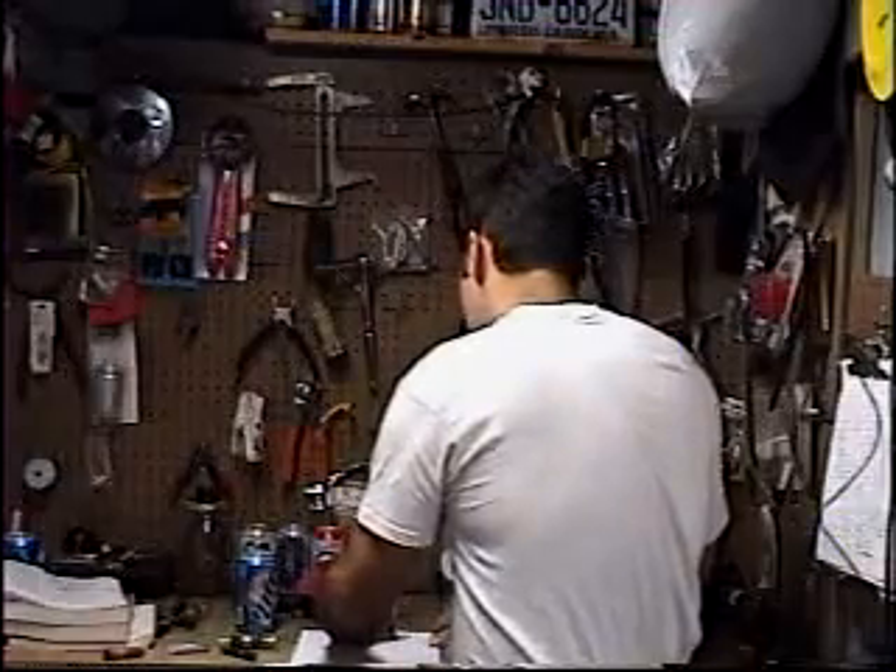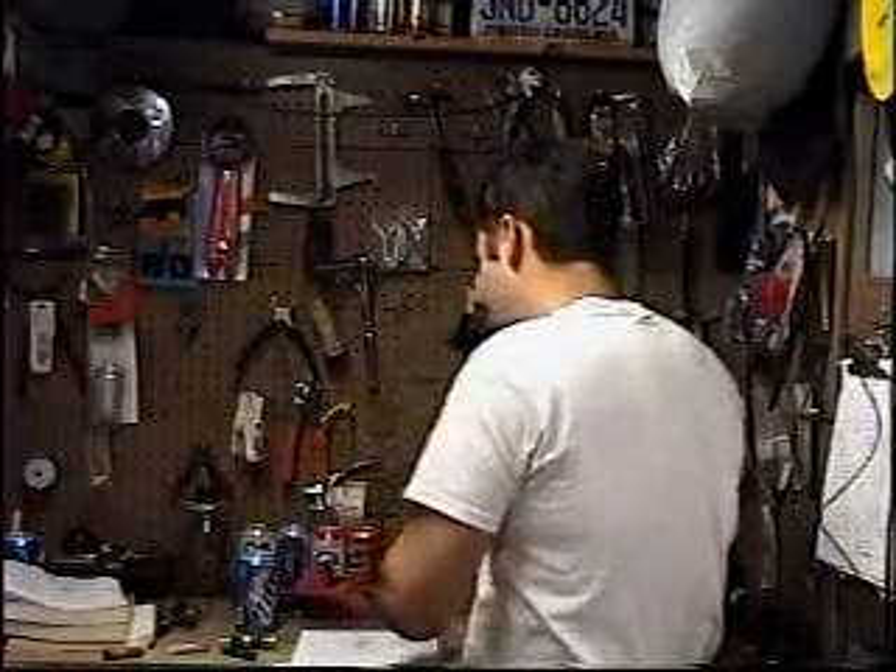You get like a shower head — a dribble instead of a spray. This causes major issues, the first of which is lack of power. The car's not going to run at its peak performance if it's not operating with a good spray, not getting complete combustion. Your plugs will foul out, and you're liable to have a miss — multiple misfires on a cylinder. Usually the injectors don't all go bad at once. You'll get one that goes bad, the car won't run on all four, you'll notice hesitation and the car shudders when you accelerate. After a certain RPM, when there's more fuel pressure, it'll start firing properly, so you'll have power at higher RPMs but it'll rough idle or won't idle at all.